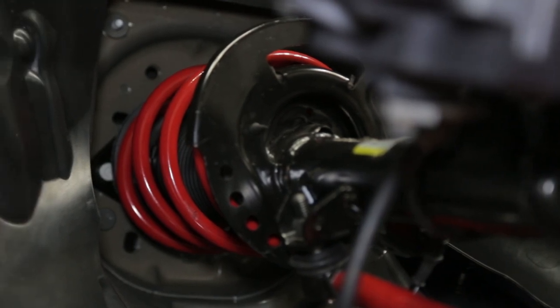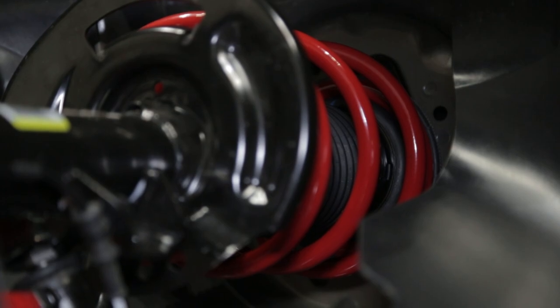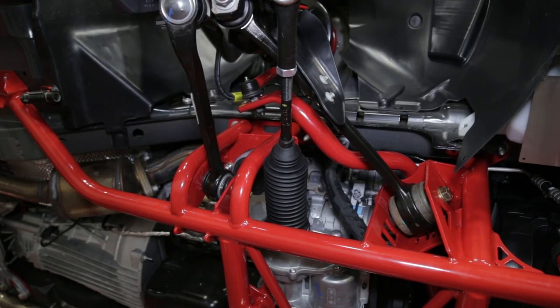And of course there's the guy that wants to go out and hammer his car on the road course — he loves autocrossing. What do you got for that driver? We've got a lot of love for the handling guy. Our front spring is a 300 pound spring — it's very heavy and very specific to the handling applications. It drops the front end that same inch and a quarter to bring the nose down to a nice height. The back is a one inch drop at an 845 pound rate, very specific for handling. If you are not going to a road course or autocross on a regular basis, this is not the spring you want — when your wife gets in the car to go to dinner she's not going to be happy. To further improve the handling we have three-way adjustable front and rear sway bars. The front bar is an inch and three-eighths diameter, bigger than the stock bar. On the softest setting it gives you about a 47% increase in bar stiffness, the middle setting about 70%, and the stiffest setting is just under 100% more than the stock bar. You're really going to feel a difference in the handling department, and combining both of those you're going to have a serious handling 2015 Mustang.